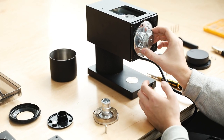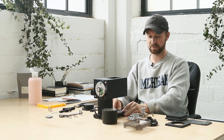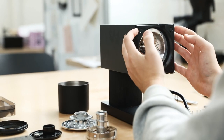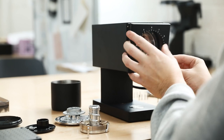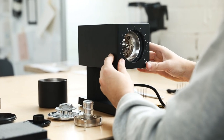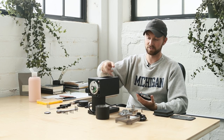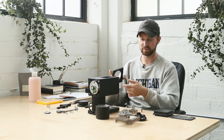You can see I've marked all of these lines with a sharpie all the way in, because you don't want to be in a position where you have to re-dial everything in if it's already set. Something important about taking this base plate off: these four detents are all spring-loaded, and knowing that you can pop this plate off pretty easily. But if you go in and try to unscrew these screws, you're going to lose the springs for the detents and it'll make a mess - we had to fish one out of the inside of the motor just a few minutes ago.